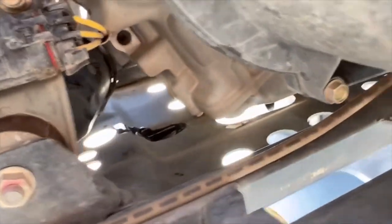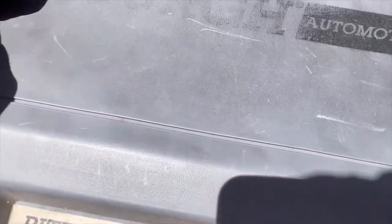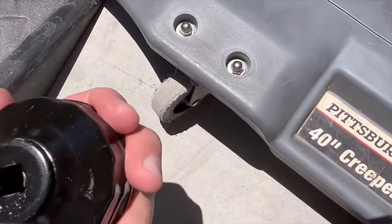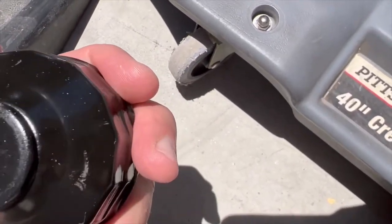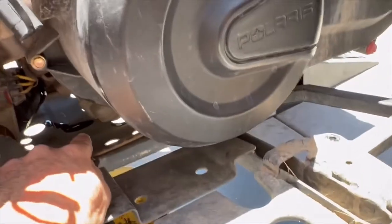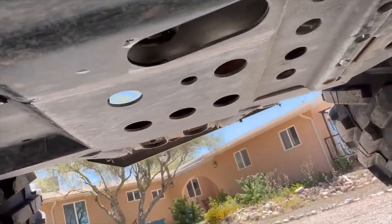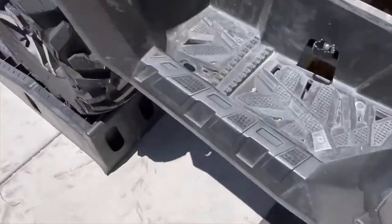We're draining the oil filter — it's in a bit of a weird spot. If yours is going really tight, get an oil filter socket — it looks like 65 to 67mm. You'll need a shorty 3/8 to get in there because you have to come in underneath the belt drive to access it.